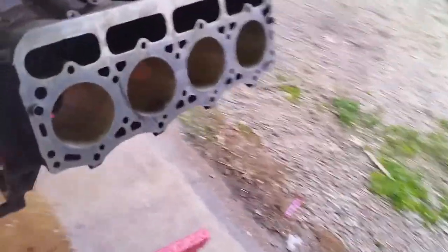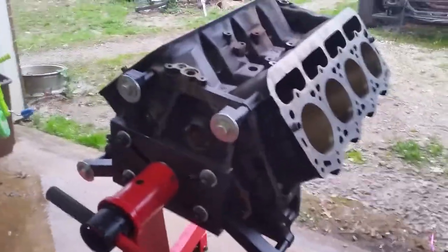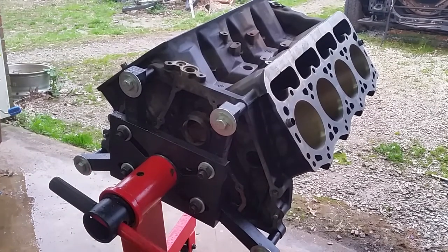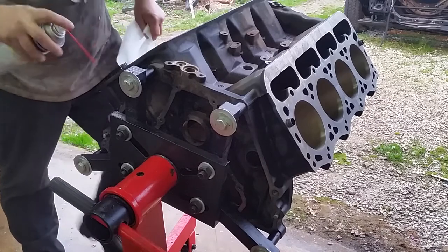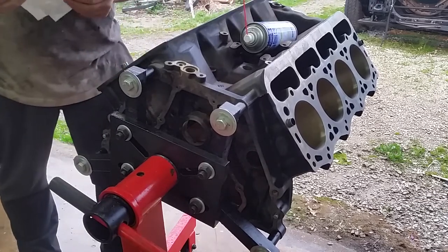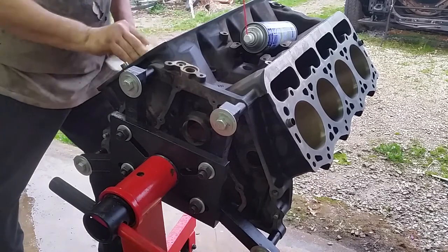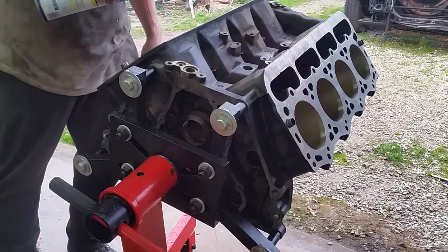Bores were spotless, shiny, brand new iron when we started. Look how much they rust up just from cleaning. It's all surface rust, comes right off, but it's just amazing. So, let me get some oil and we'll oil them down. I like to use white paper towels because I can see what I'm pulling off of it. So, WD-40. Don't care about rust, just care about dirt. No dirt, just rust. Good. And now it looks real pretty. Do not be scared to use too much. Gotta take your hand.